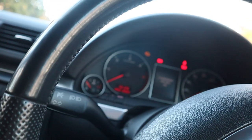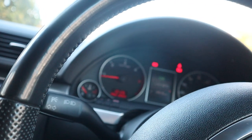As you can tell, that didn't fix my starting problem. I think it's just a flat battery or a damaged battery because there's a lot of water that drains down where the battery sits but the drain is blocked. So I think I need to take the battery out, clear that drain and just replace the battery. But it's been going like this for well over a year now, so I kind of just can't be arsed. I will one day do it, just not today.